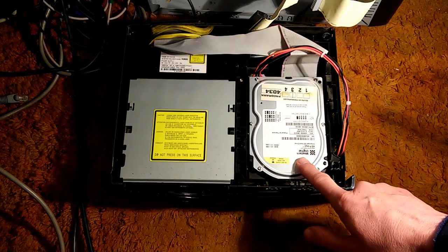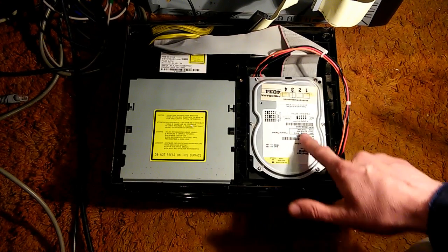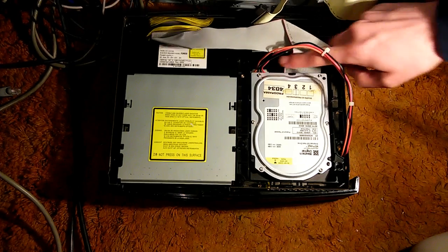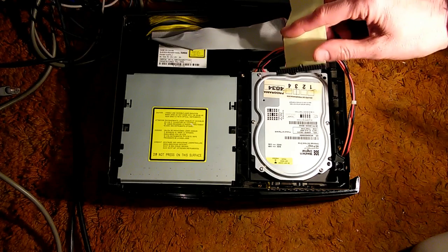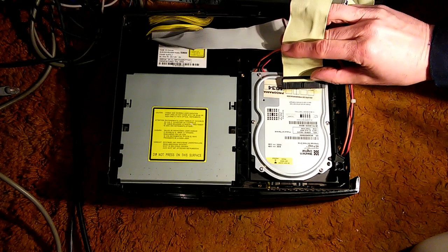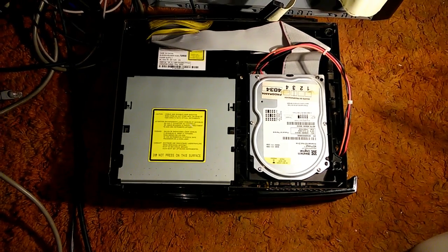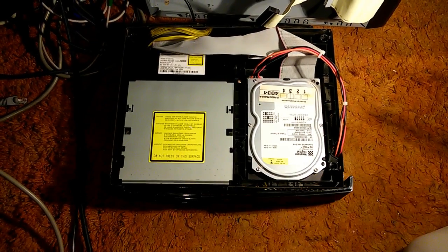The key to unlock this drive is on the firmware. Once we start the Xbox, it will automatically unlock the disk drive. And with the drive unlocked, but still powered up, we can pull this IDE cable and attach this IDE cable from the computer, and now we can read the files on the hard drive and we can write to the hard drive. Once we do that, we then reconnect the cable from the Xbox. And we should have the files on there that we need. And hopefully we will bring this thing back to life.